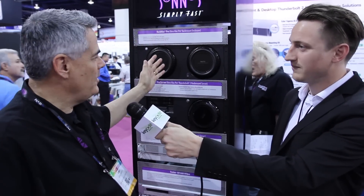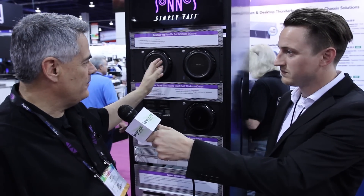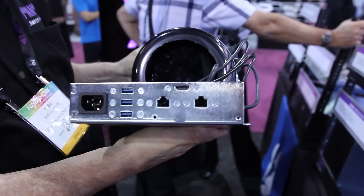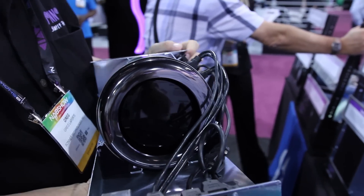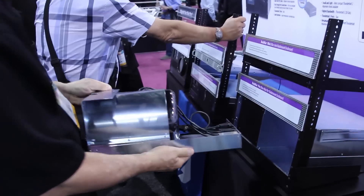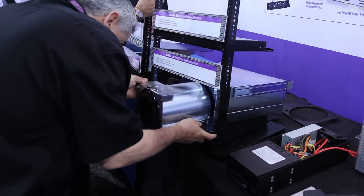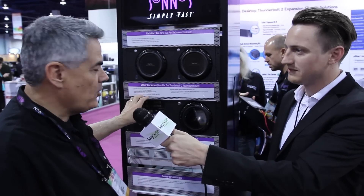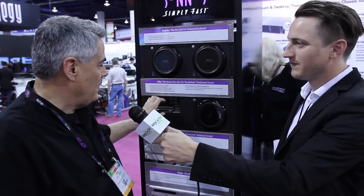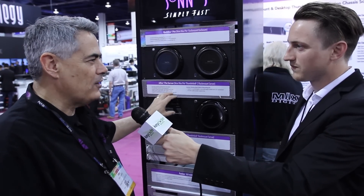At the show we've announced the X-Mac Pro server and the Rack Mac Pro, which will hold one or two Mac Pros in a rack mount configuration. The X-Mac Pro server holds one Mac Pro and has expansion — three-slot Thunderbolt 2 PCI expansion — and will accommodate up to three full-height, full-length cards. It also has room for what we call a Mobile Rack Kit, which will hold two and a half or five and a quarter inch bay rack mount drives.